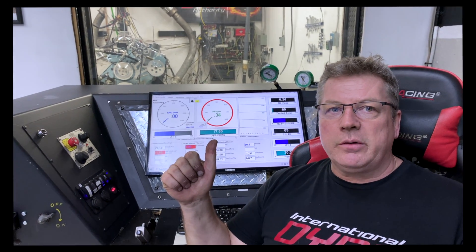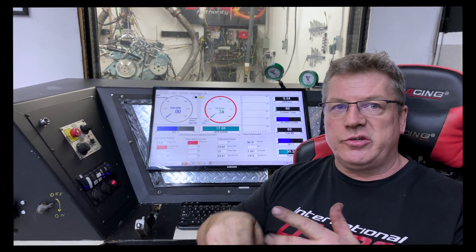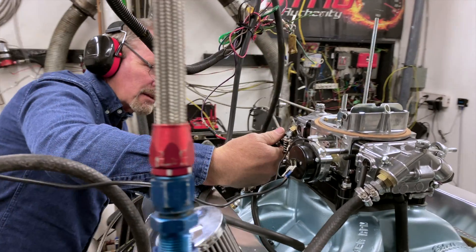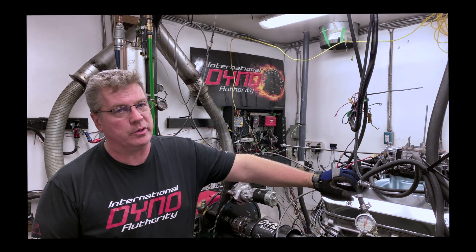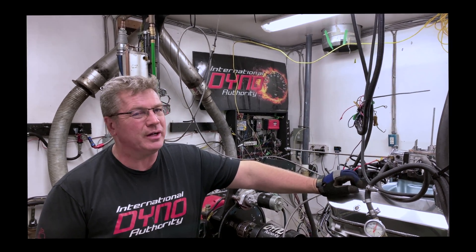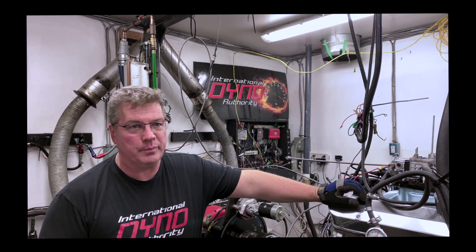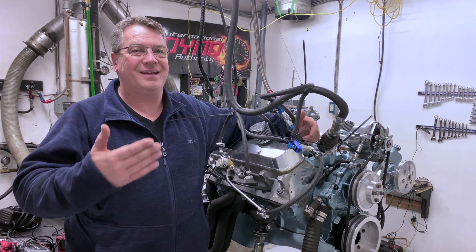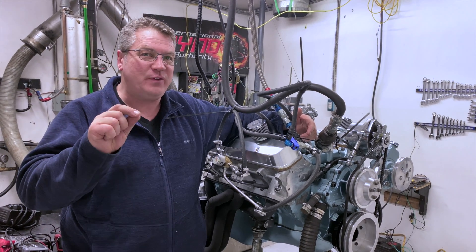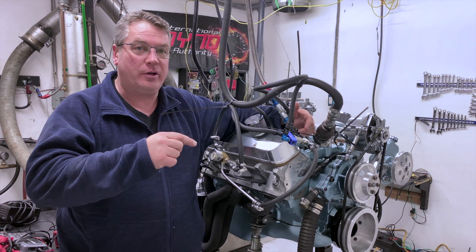We've checked for oil pressure and water leaks, and now we're checking for fuel leaks, working our way through each system. We check for spark — we have spark. We turned on the fuel system separately and found a small fuel leak. The line wasn't as fresh as it could be, so we cut it off, shortened it, put it back on and tightened everything up — fuel leak is gone. Now we're going to start the engine for the first time and verify ignition timing. I like to see somewhere between 8 and 18 degrees — right about 15 makes the engine start very well.